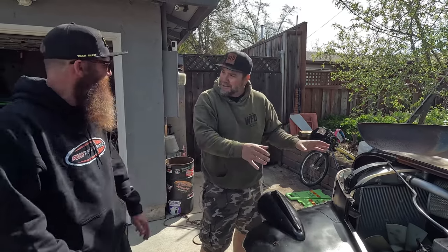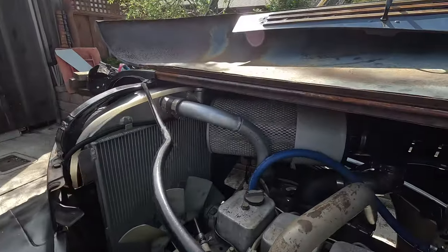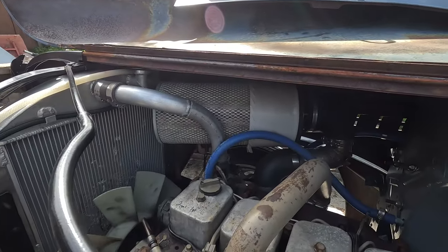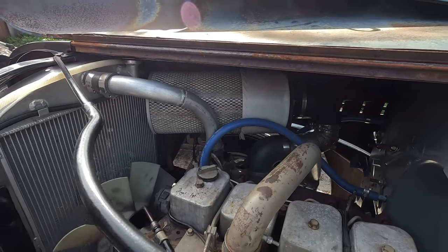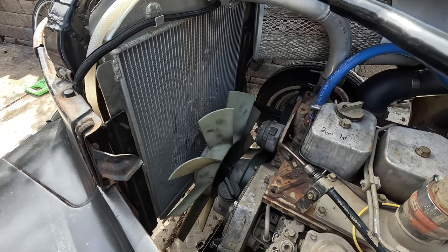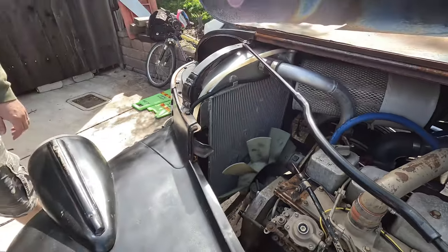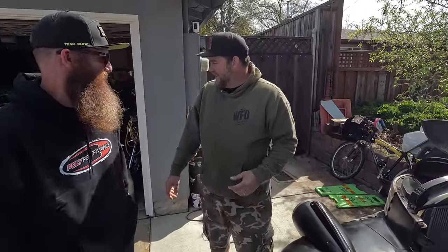So you went the exact opposite direction — a nice Gucci rack and pinion so it steers nicely. The air cleaner is repurposed from the race car. It's got a mechanical clutch fan, and it runs real cold — I had to put a new thermostat in because it wouldn't go over 110 degrees.